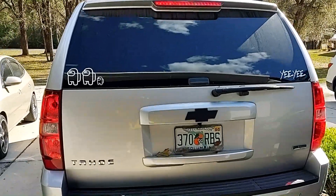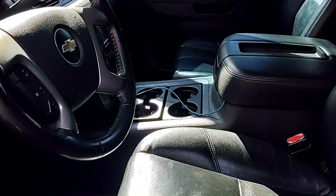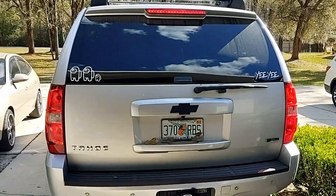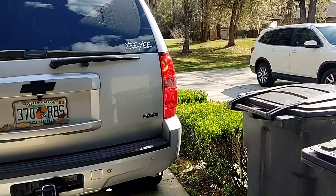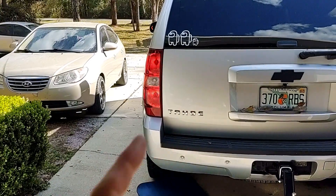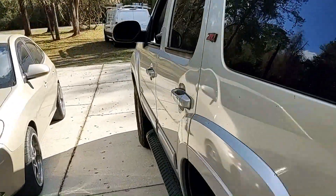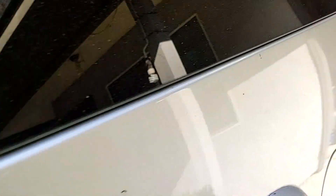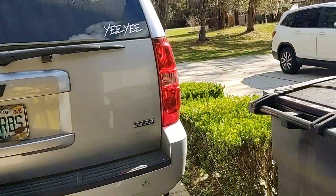With the flashers on and the brakes applied, the third brake light is on, plus both of these bulbs are lit over there. It's still flashing fast because I have LEDs in the front and only one load resistor — I still need to put resistors on the front LEDs. But the functioning does work: brakes applied, both bulbs bright, third brake light on.